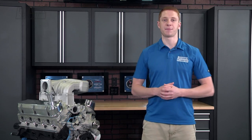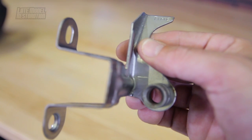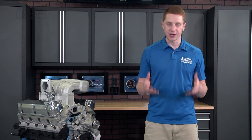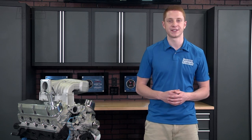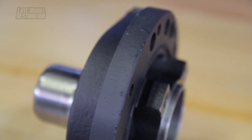Lastly you'll need a harmonic balancer. 50 ounce or 28 ounce imbalance options will be available, as well as a Ford Racing balancer which features a removable counterweight for applications requiring a neutral balance. If your engine was custom built, you'll definitely want to check with your machine shop that did the balance work.